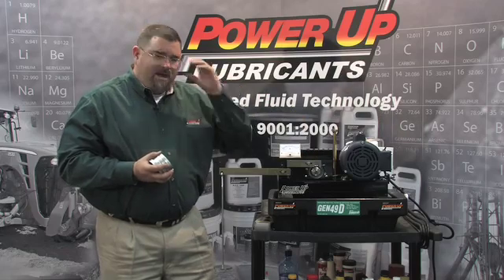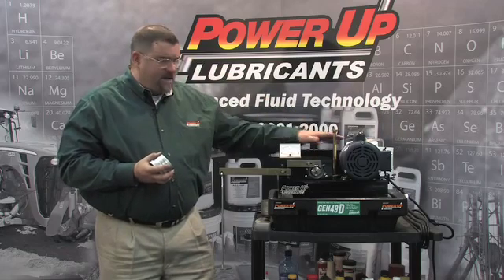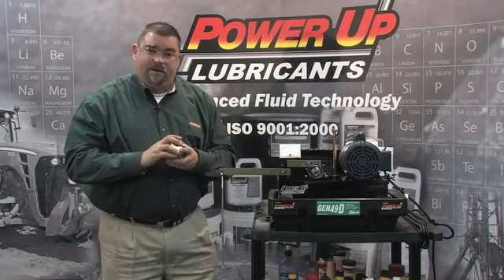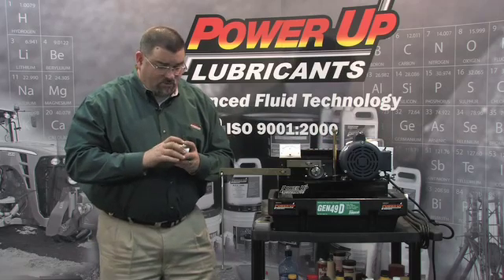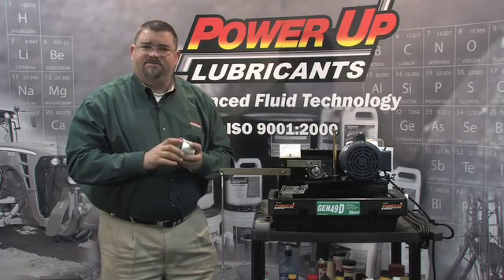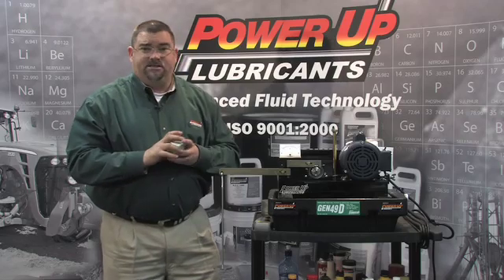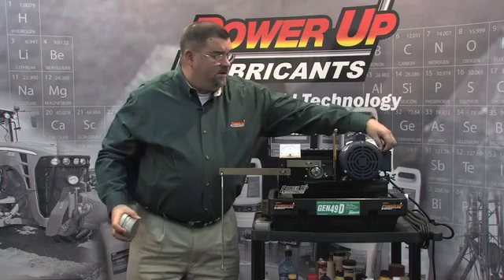But we're running on the size of a pinhead, and the engineers back at the Marin Laboratory tell me that on a new contact area on that race and on that bearing, these weights can actually represent over 7,000 pounds of pressure per square inch. So it doesn't take a lot of weight to get this bearing to seize up. Let me demonstrate.